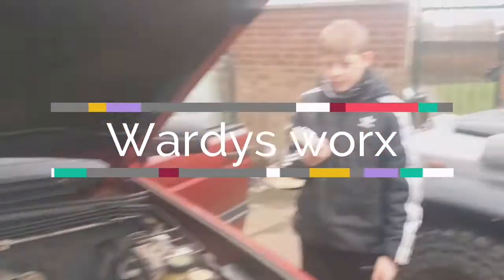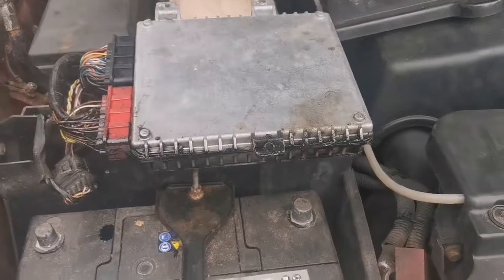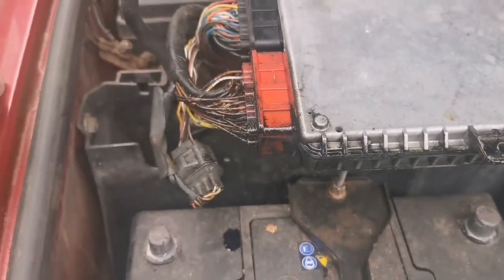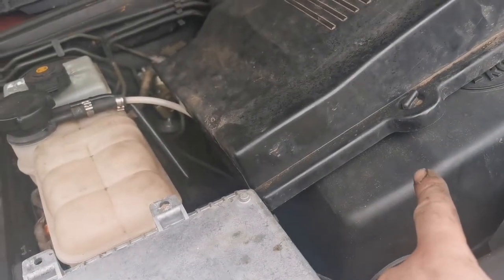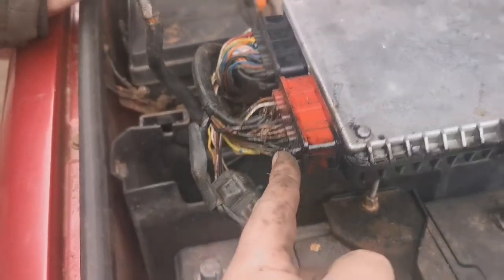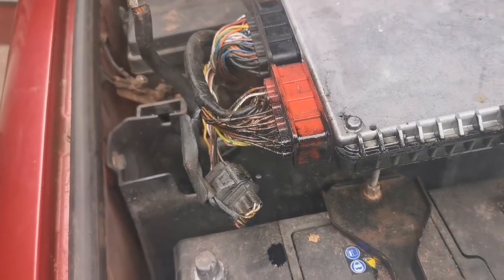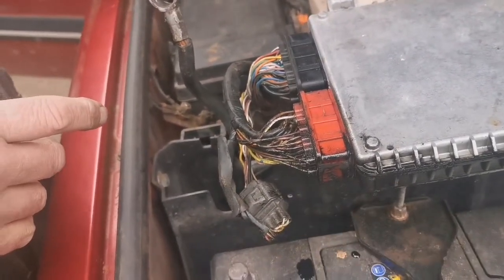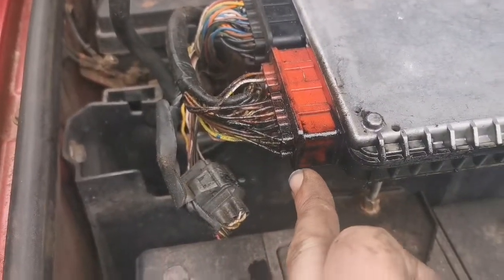Welcome to WardysWorks, apprentice. This is a big problem with TD5s. Oil travels from the injector wiring loom up the loom and then into there, and that causes the ECU to throw absolutely wobbly. You need to make sure that this is clean, especially when you're buying one. We bought ours off eBay, but that's something you'd 100% want to check.